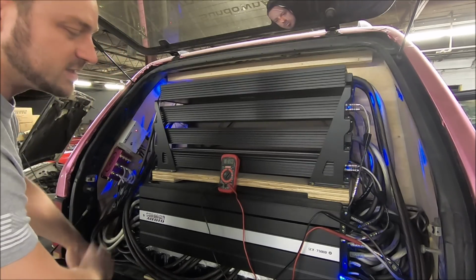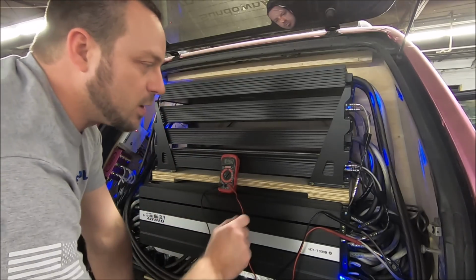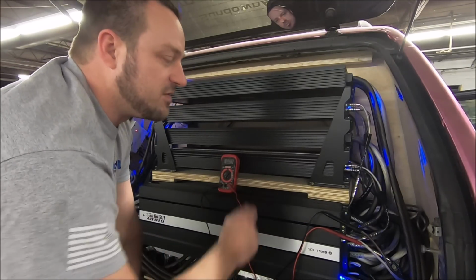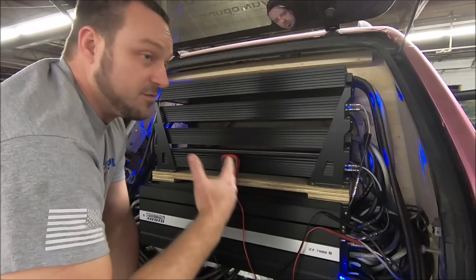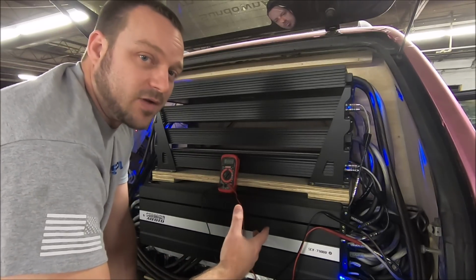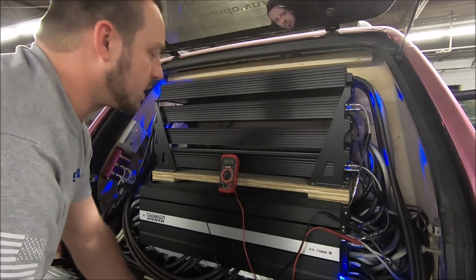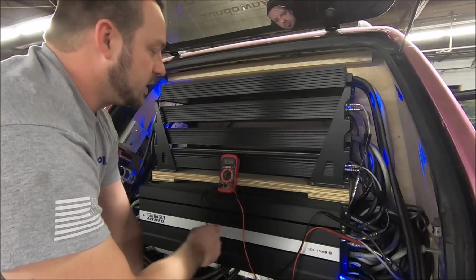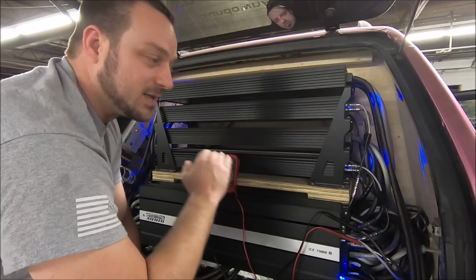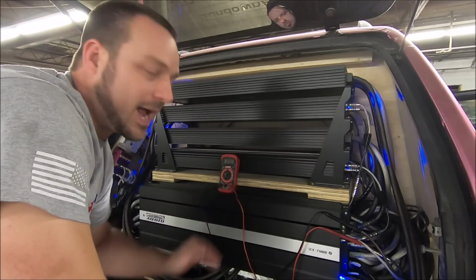And when I adjust the line driver, it adjusts all 8 amps simultaneously. So instead of having to go through and fine tune each amp 8 times for full potential on a full tilt burp, checking it every time, and at those loud volumes, like I mentioned earlier, adjusting one amp can throw other amplifiers and other voice coils off. They're all matched, they're all good to go. I have one knob, one setting. I can turn up, I can set, get everything dialed in perfect down to that last little millivolt I need on my output side.